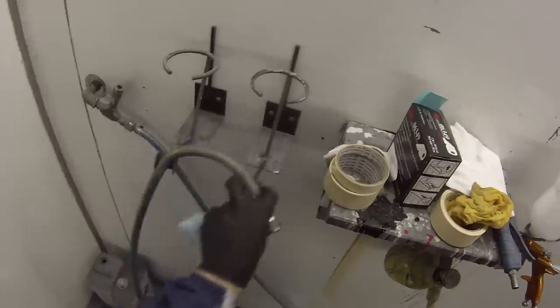The TE10 has really small holes where the air comes out, so it needs less air to run. The safe working range I've found is about 18 to 22 PSI on the regulator. Drop it down to 18 PSI if you want a nice thick European-style peel and wet finish; go up to 22 PSI for a more Japanese style — like Mazda-type — thinner orange peel. Adjust your fluid settings too: for this kind of car I'd wind the fluid out to about three and a half turns, whereas for a Mazda-type you'd go about two and a half turns out and move a little faster on your passes.